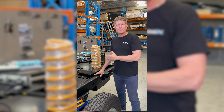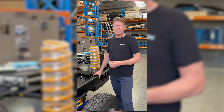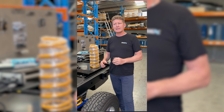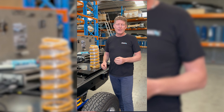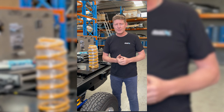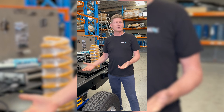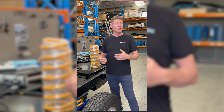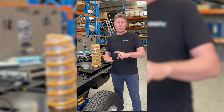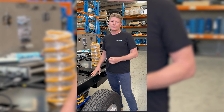Would we do a leaf spring suspension at four and a half ton? Technically you could, however it wouldn't be a great vehicle. As we all know, if you're going to run leaf springs you need to have a certain amount of constant load. You can't ask for a 4.2 ton GVM on leaf and then drive the thing around at 3.3 ton — the springs don't work. Springs are designed to carry load; the more load you want to carry, the heavier the leaf pack has to be. Hence ride quality, shackle angle, all those things will suffer because they need constant load.